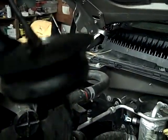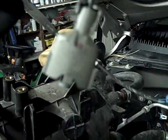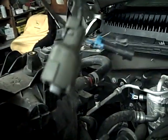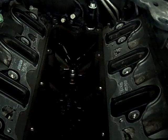To get the plugs off the sensors, you've got to slide these things up the wire before you take the pan off. Then you squeeze the plugs from the left and right — not from the skinny side, but from the outside — and use a pair of pliers to pop it off. From here you can see the oil sending unit a lot better; that's the new one I just put in. Next to it is the camshaft position sensor.